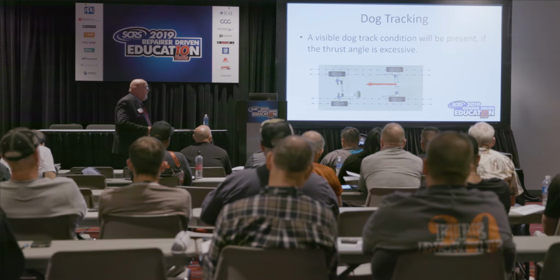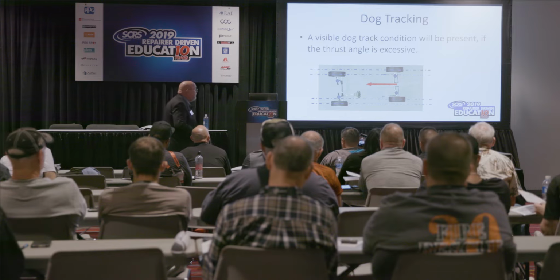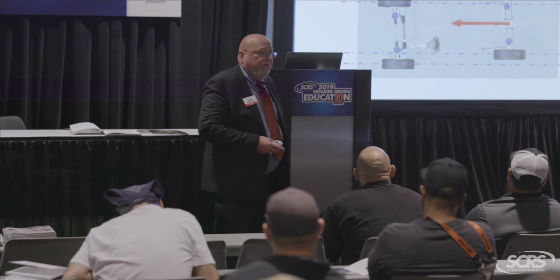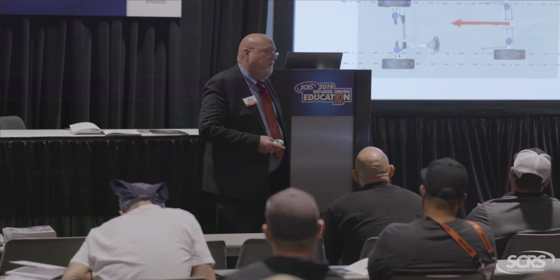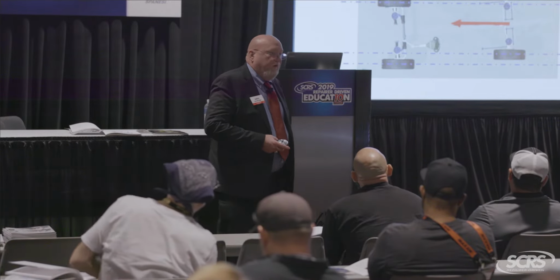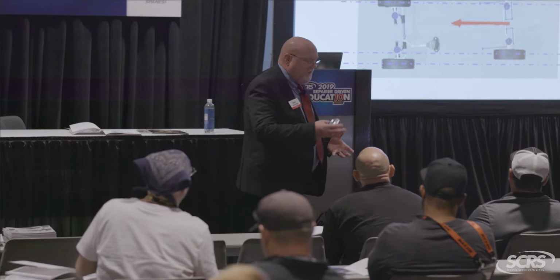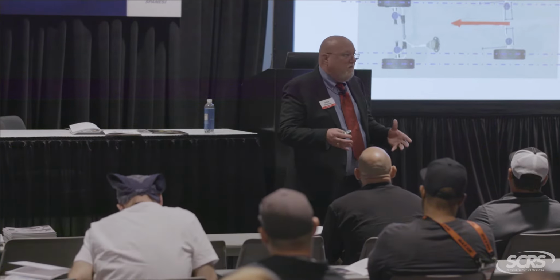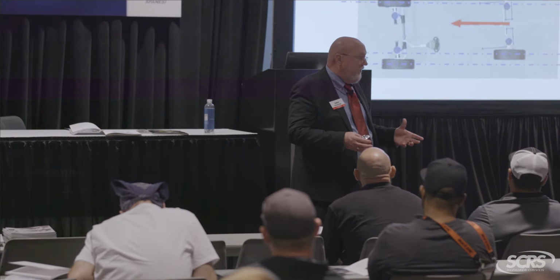I've got 4 tires in 4 different track positions. Is this starting to make a little bit more sense now? What do you think this is going to do to electronic stability control while I'm cornering? So this could be your car where the steering angle sensor wasn't clocked and we've got this mess going on. This could be the car that's going to give you a drivability complaint.